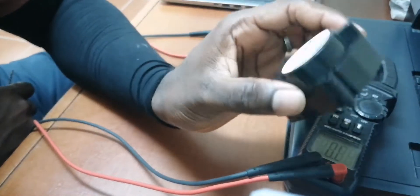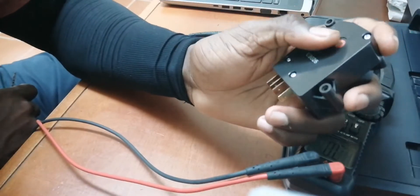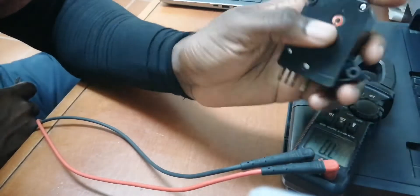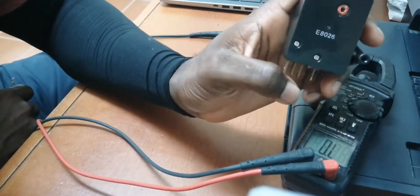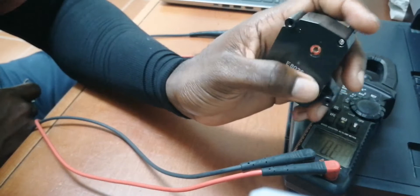Today we have a timer for your refrigerator. This is an analog timer — there's a clock inside here. Some timers have a different time span; some have a time span of six hours, some have a time span of 10 hours to run before they start to defrost.